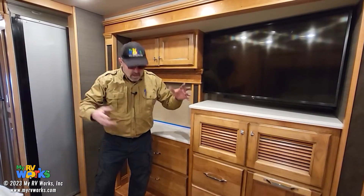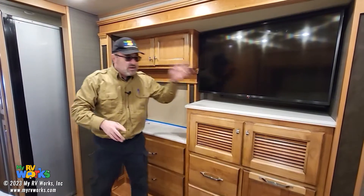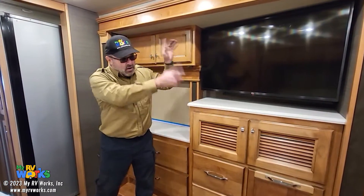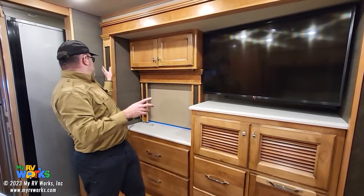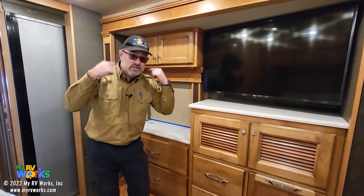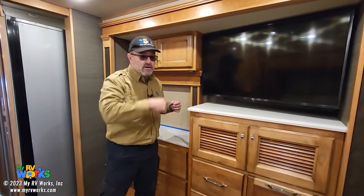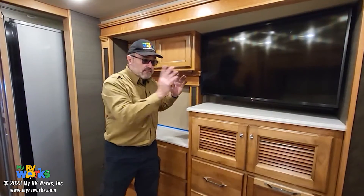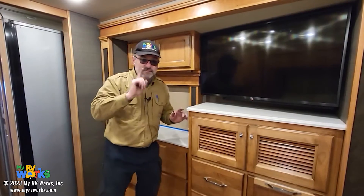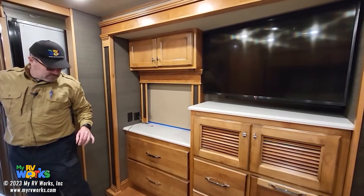I'm going to bring this room in — it's all the way out right now. Because it's not synchronized, one side might stop and the controller doesn't know. What we're going to do is bring it in just a little bit and then bring it back out. My human ears and eyes are going to listen for those motors to amp out at the same time. If I hear one hitting before the other, I'll bring it back in a couple inches and try again — only a little at a time — until I'm convinced those motors amped out at the same time.